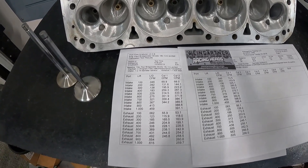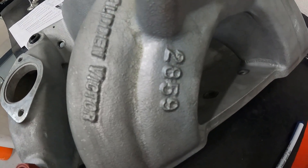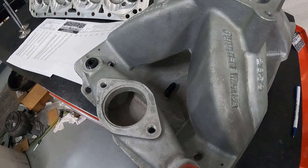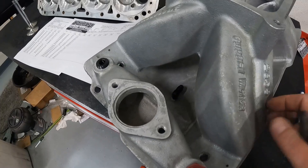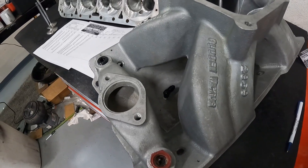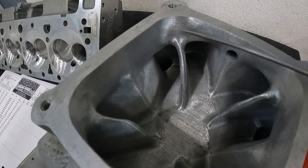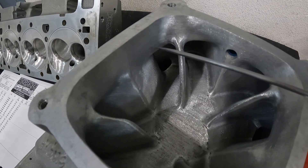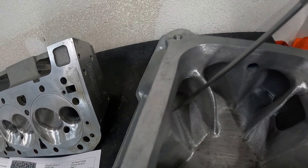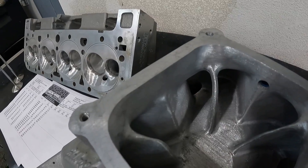I also need to show you the other part that goes with this — the intake manifold. He is running a 29.59, which is a one-piece design, so you don't have to run the tray and the spider separately. When you get it from the factory they usually mill it down to about here and it slopes this way, cutting the tops of the dividers with a sharp cut. I should have taken a picture before but he'd already done some work to it.